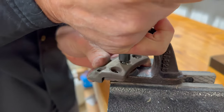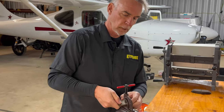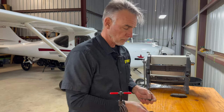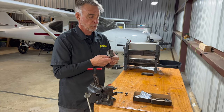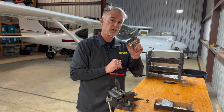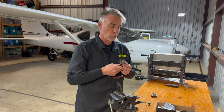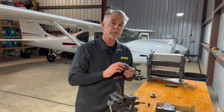With a little bit of effort it will push the brass rivet right back through the backing plate. We'll repeat the effort for the other two. Once all three rivets are out, you should be able to pull the material away from the backing plate and toss it. Now, while we're looking at these, it's probably worthwhile to determine when to replace the pads. Generally speaking, you want to replace these before the material wears down to the point where it starts contacting the rivet heads — catch them before they get down to the rivet. The rivet is made of brass, so it's softer than the material it's contacting. Nevertheless, replace these before you get to that point. Another thing to look for when you pull the material off: make sure the inside of the backing plate is completely flush. You don't want any burrs or any extra material there, because that can lead to cracking of the pad.